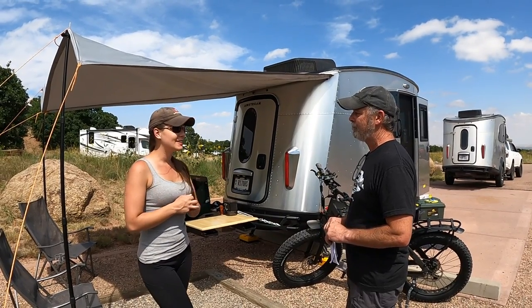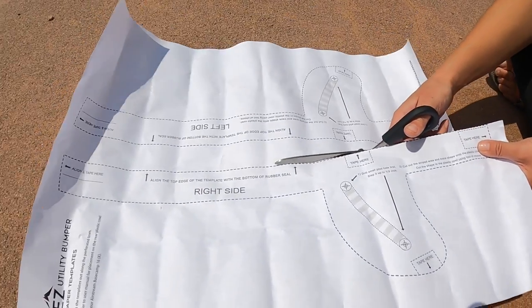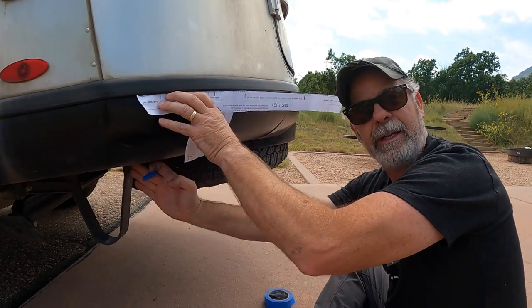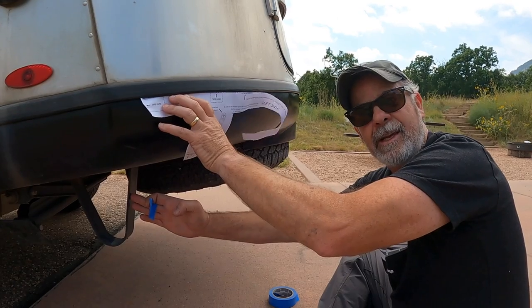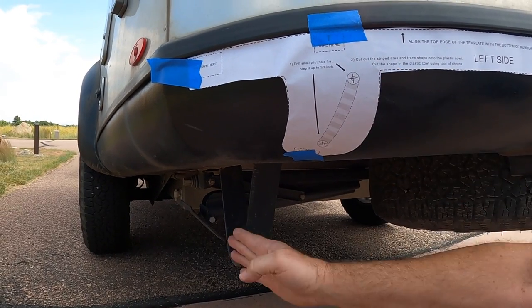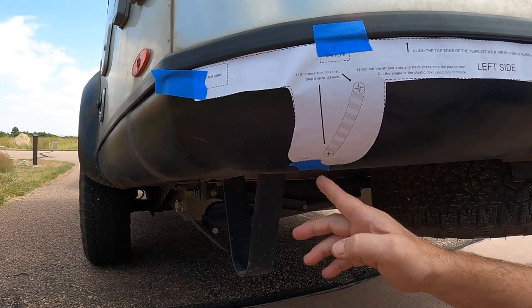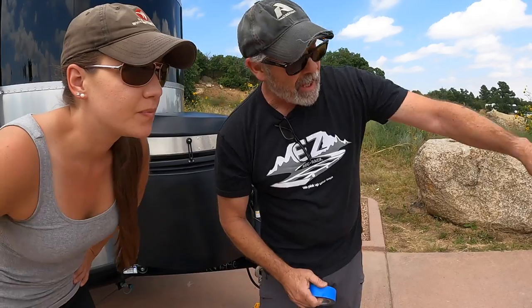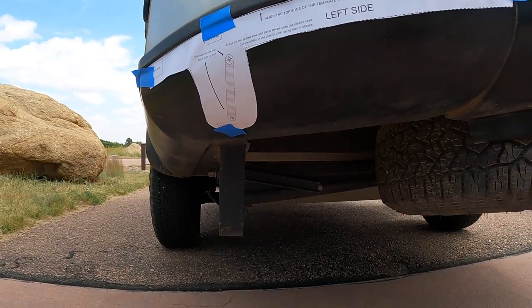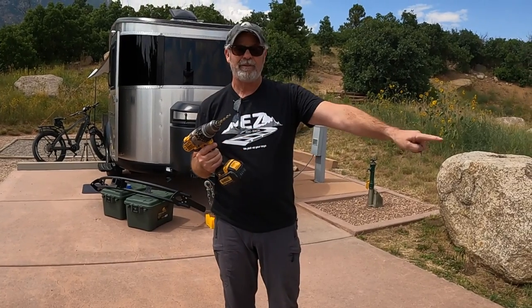So let's get it on the Basecamp and see what this takes. We made templates — the templates get you really close, but the only real lineup is this brace. As long as the cut is just a shade inside this edge, you'll line up perfect. When you line up these two edges in a straight line on the outside edge, that's when you're cutting and your blade will slide right in and go right into the frame of the trailer. The line on paper will look curved, like an arc — it looks deceptive, but it's really a straight line because of the curve. This is a 9/32-inch drill bit, the same one I'm going to use in the frame.